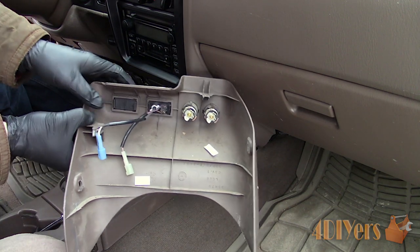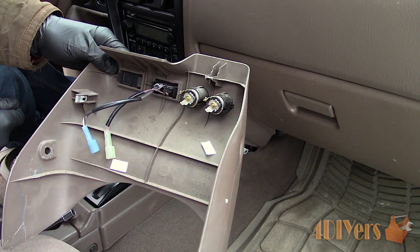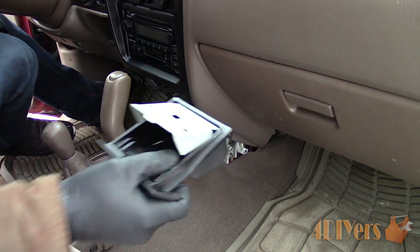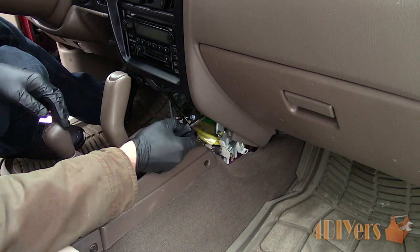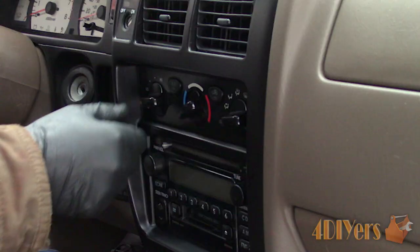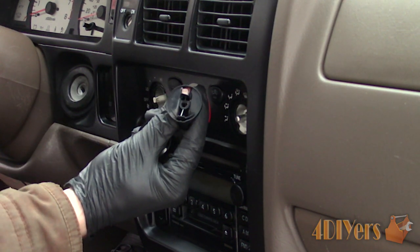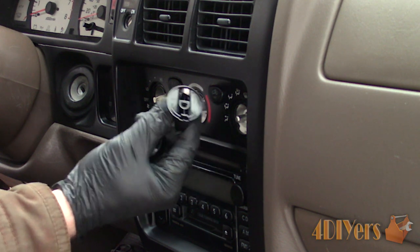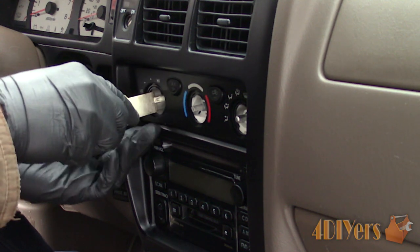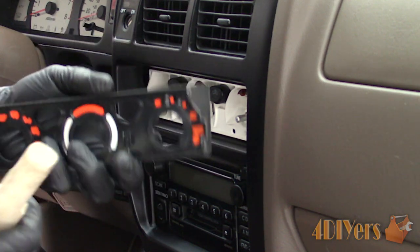On the back side of the panel there are two snap clips — one along the top on the right side and another along the left side. Remove the ashtray by depressing the top metal portion and pulling straight out. There will be a Phillips screw on the bottom which needs to be removed. For the HVAC panel, pull off the rotational knobs — they simply slide into their location and have an alignment groove so their position can't be mixed up. If your fingers are too large, use a nylon trim tool to unclip the HVAC panel, starting from the outer hole and moving your way across.